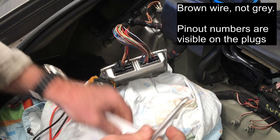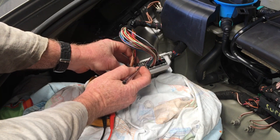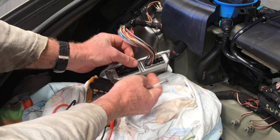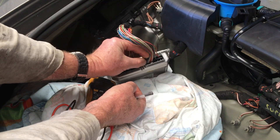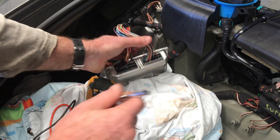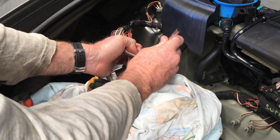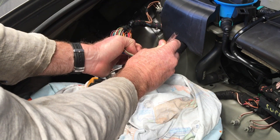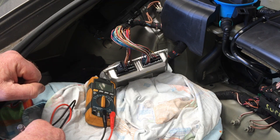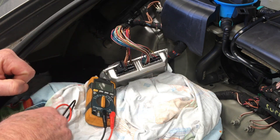The pinouts for the distance sensors: pin 21 is that one in there, and then the three along this side. That's why I've separated those wires out, so I can probe from the back more easily. Pin 4 ground does go to ground, so you can either put your probe straight down into the back of that pin, or just select ground anywhere on the car — it's exactly the same. Then we're just going to probe the back of each of these to see what the outputs are.